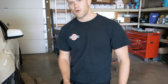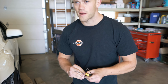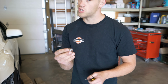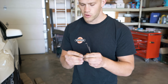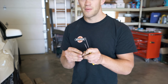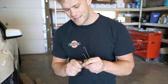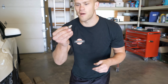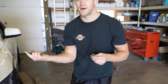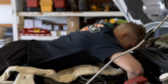All right, so what I ended up doing, as you saw, I put the thread tape on there and threaded it in. I'm like, okay, this definitely isn't a pipe fitting. It's not getting tighter. So I called English, and there's supposed to be a crush washer on here, not thread sealer. So I pulled it back out. I tried to get all the thread sealer out of the holes with these little picks here. I may have a crush washer here. If I don't, I'm gonna have to run into town real quick, grab one, and then we'll be back on our way. Okay, so I found a washer here up in the garage. We're back on track. Let's get this fitting on, and then we can get the manifold back on. I actually pulled it off. Get the manifold back on, and then wastegates and turbo.